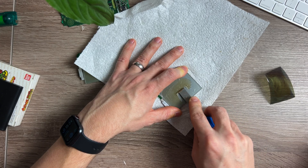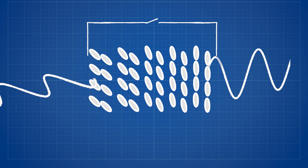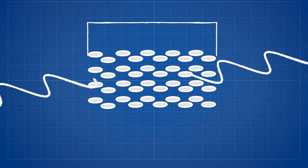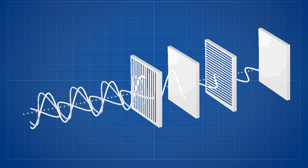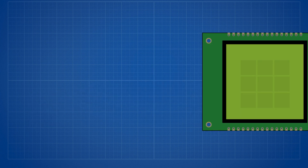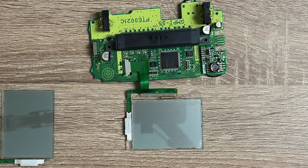Talking of which, I've got a new technique so I'm going to be done in no time. One more interesting property of liquid crystal is that if you apply a voltage across it, it begins to untwist the light. This, combined with the two polarisers, gives you the same effect as just twisting polarisers — it will reduce the amount of light that can get through. So imagine you could apply these voltages to different pixels: applying the correct voltage to a certain pixel could result in the light being blocked, thus resulting in a dark black pixel, because no light is being reflected off that back reflector. And if you adjust the voltages applied, you can control the amount of light that does pass through, resulting in that grayscale appearance seen in these displays. And for all this to work, you need to start with polarised light — otherwise there'll always be something reflected back. So let's go back and put a polariser on the front of this screen.